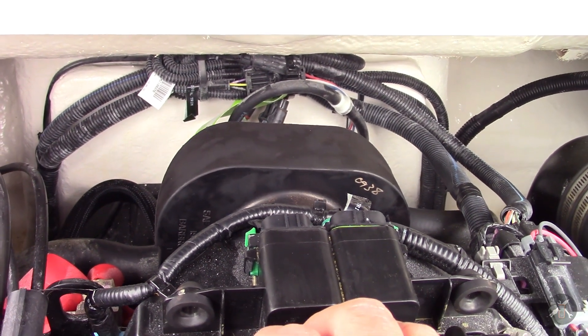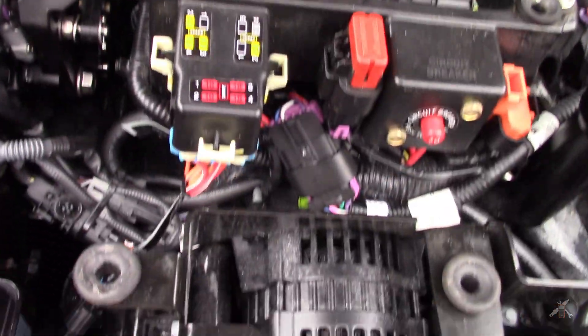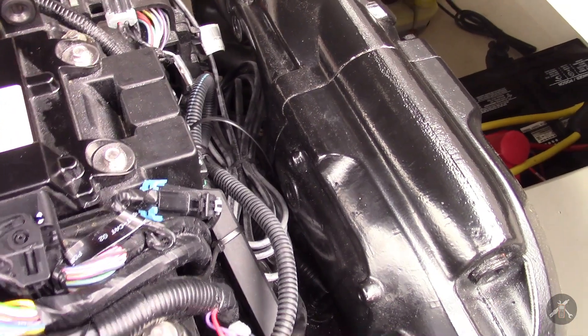If you need to clean fuel injectors, you would need to put something in the fuel and run it through the system so that it operates normally with that cleaner in it. An oxygen sensor resembles a big spark plug but has a ceramic element on the end that sticks down into the exhaust stream. That element changes voltage depending on whether the mixture is rich or lean — whether you have excess oxygen or not. These things are very sensitive: they can be poisoned by certain chemicals. Silicone is really bad; fiberglass dust, which you get in boats if you're not careful, isn't much better. Different chemicals will poison the oxygen sensor and cause it not to work, and you'll get a check engine warning and have to get it replaced.